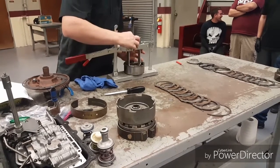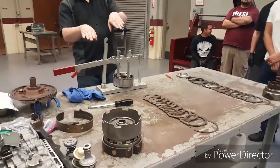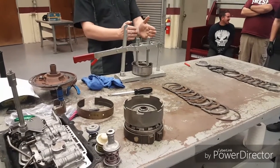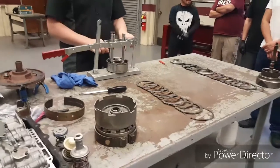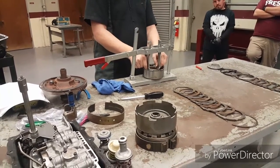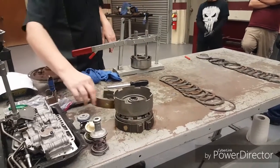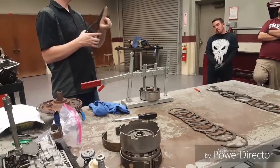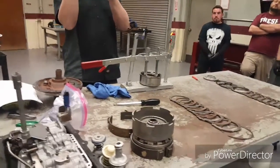How many of these tools do we have? I've got one for every bench. When I look at this thing, the first problem I have is you can see I have a bit of a down angle, which means as I press it, one side is going to go more than the other. I also have an unusual kind of snap ring — these snap ring pliers do not have the pin sticking out, that's not the type we're dealing with. This one has a couple of flat edges on it. So what we have to do is get into those flat edges and simply spread this snap ring out to get it out of here.